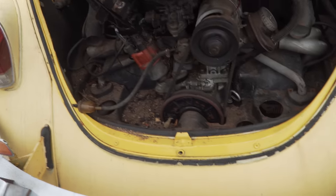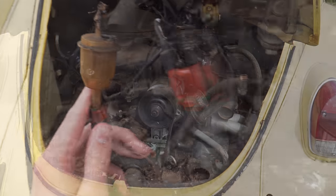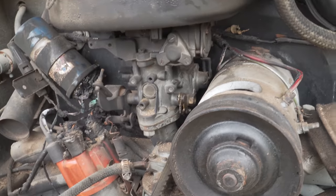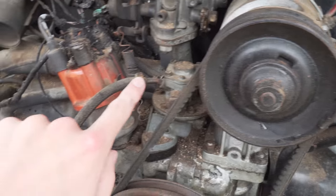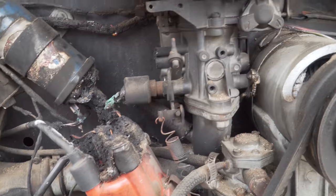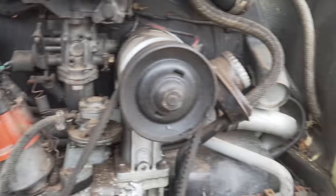I'll give you quite a big hint — what's going on right there? Let's open this up. Oh geez, what the heck happened in here? So yes, this motor did catch on fire. It happened in the typical spot — the fuel filter. I learned on my other car not to put it there after I did the will-it-run video. Everybody says to relocate that fuel filter, so on that car I now have it underneath, not in the engine bay. Part of the reason this one popped off is because there were no hose clamps. This is typically how these cars catch on fire — either the fuel filter or the little stub on the carburetor pops out, you get fuel leaking, and it always ends up on the distributor because you have spark in there and it just ignites the fuel.